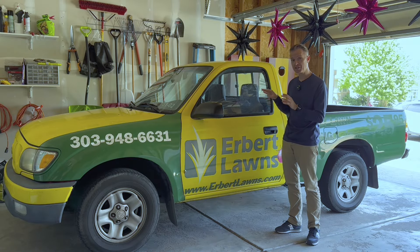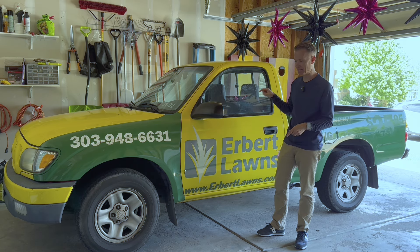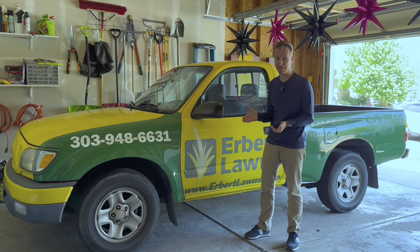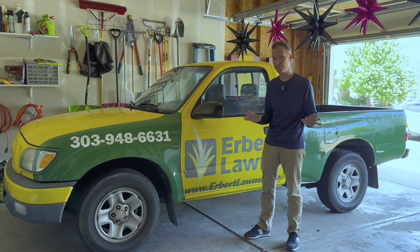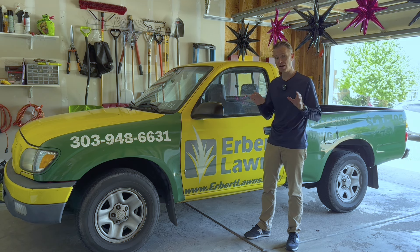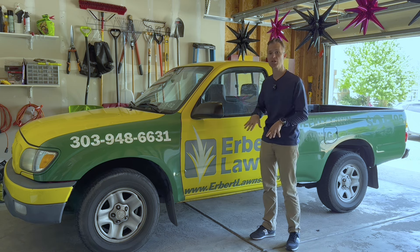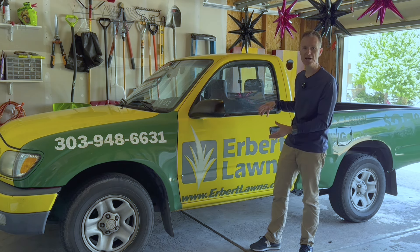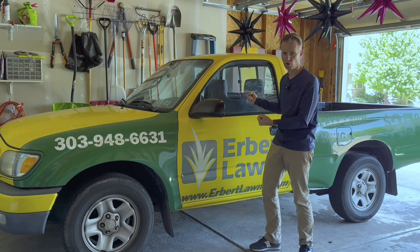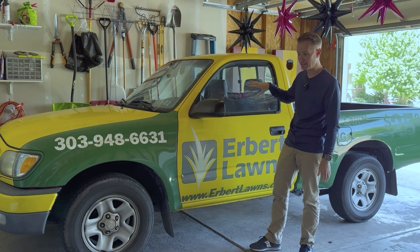The second vehicle I considered was a 2002 Toyota Tacoma four-cylinder, two-wheel drive — an easy choice to consider because I already own the truck. It has a 2.4-liter four-cylinder, a towing capacity of 5,000 pounds, and a 500-pound tongue weight. That's huge for a little truck. One key difference is that cars have a unibody construction while trucks have a full frame. Trucks are generally made for carrying and towing — they're work vehicles, made to get beat up.